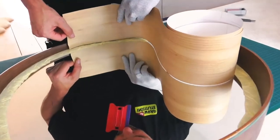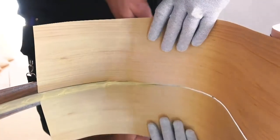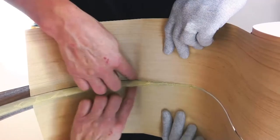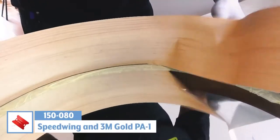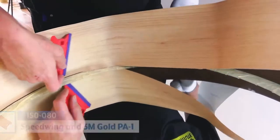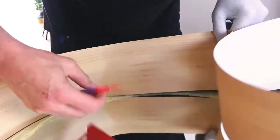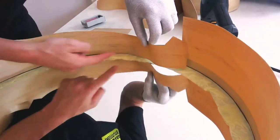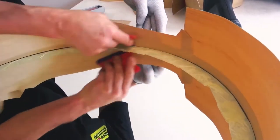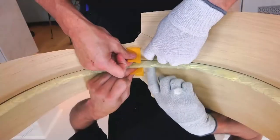Release the liner roughly 10 cm and lock it in place. It's very important that this edge of the panel is 100% straight, as if it fits properly right on the edge, it means no knife will have to cut away the excess film. Once this is set, simply release the liner in increments and squeegee it onto the surface, making sure the material stays nice and uniform. Squeegeeing in roughly 20 cm segments at a time is definitely the key, and always use the hard side of the squeegee to tuck it in the gap — the buffer side for the main surface, hard squeegee for the edge.